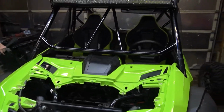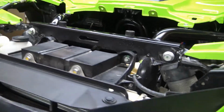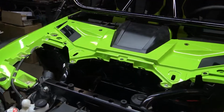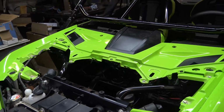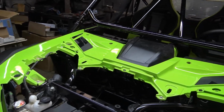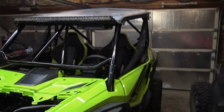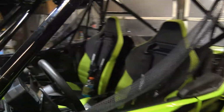All right, guys, I know we've been time lapsing for a while, but basically we got these wires buttoned up in here, got the fuse block up in here. Unfortunately, if you do have a problem on the trailer, you would have to pull this cover. But what's nice about that fuse block is, if one does pop, it lights up red on which one. So technically you could just pull the rubber off the front and the hood and look up in there and change that fuse from right here. Wouldn't be too bad. But other than that, the machine is buttoned up, harnesses are back in.